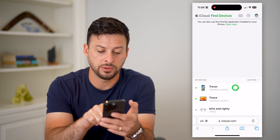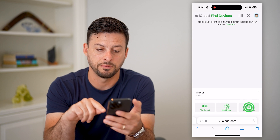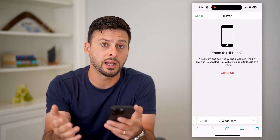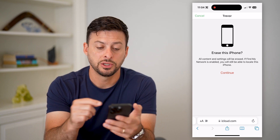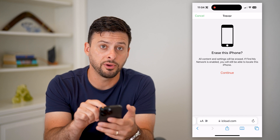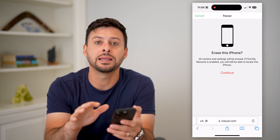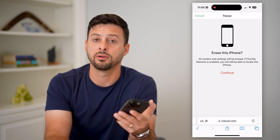All I have to do is tap on the iPhone and then tap Erase at the bottom right. The key is that you cannot change the passcode — even if you forgot it — from another device. You can only erase that iPhone. By entering your Apple ID, it knows this is your iPhone and you can remotely erase it. Just tap the Continue button, erase that iPhone completely, and then you'll be able to set it up with a new passcode, whatever you choose.